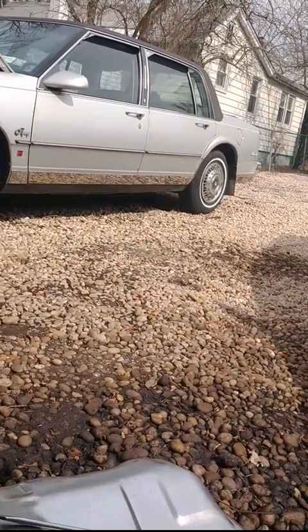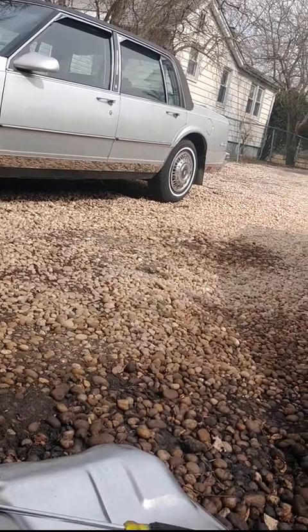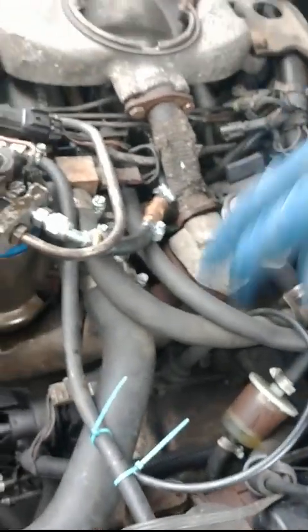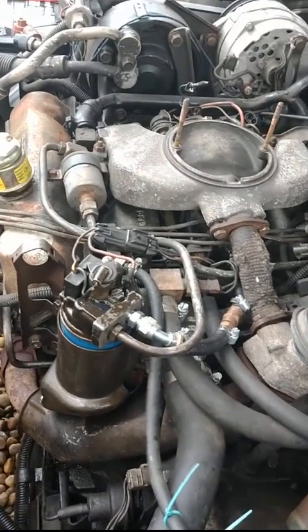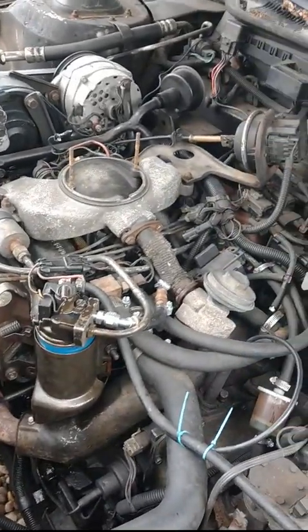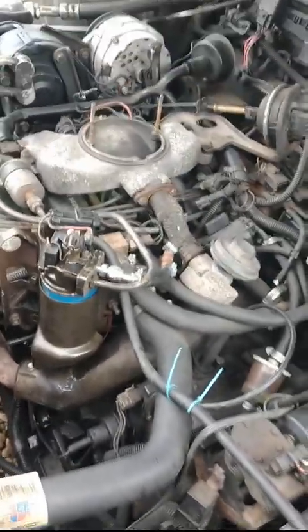Now I just got to jack this thing up on the rocks like I did the other day and try not having it fall on me — it kind of did scoot over in the back, so I've got to get two jacks on it. It's been running for about three minutes. It was really shaking a lot when I got it running, but I did get it running relatively fast. There was a lot more pressure coming out of the bleed hole. I saw the air bubbles come up — it bled through pretty quick. I had to give it three-quarter gas pedal while cranking it and it just bled out and started, but there was air in the lines obviously.